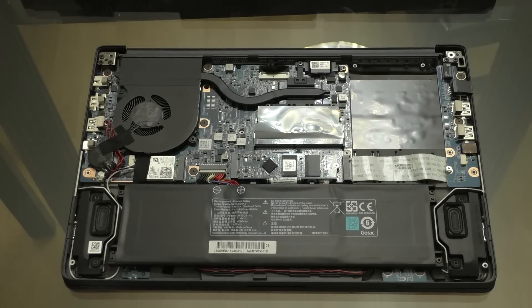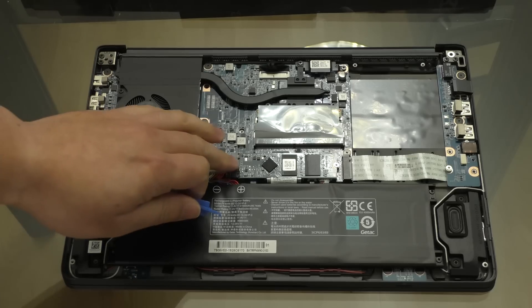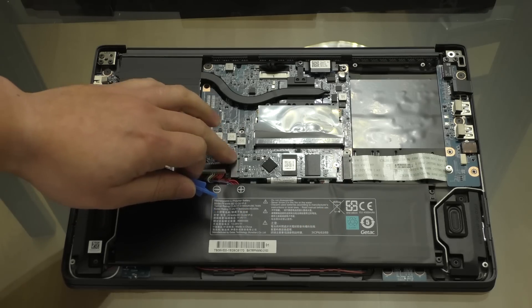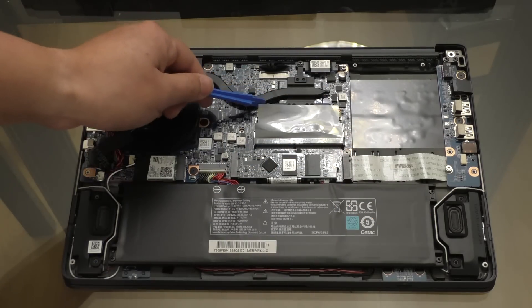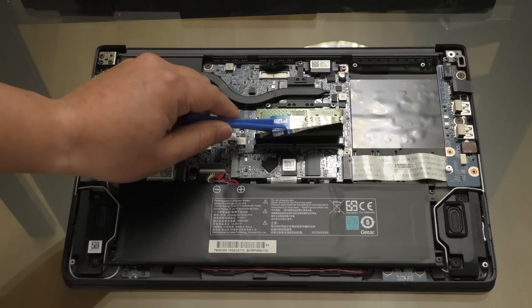Or 256GB if you have the M142. Looking at the innards of this laptop, we can see over here on the left, just below the CPU cooling fan, we have the wireless card. Next to that we have the native solid-state drive, which is SATA M.2 because it's got the two cutouts. And then to the right of that we have the spare NVMe slot, and then under this plastic sheet here we have the original memory or SODIMM, so we'll be replacing that.